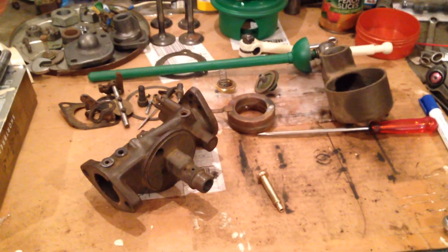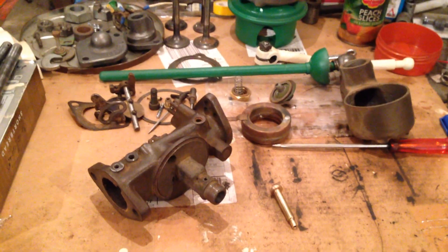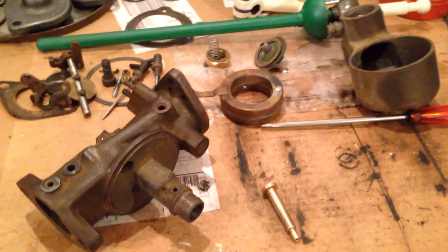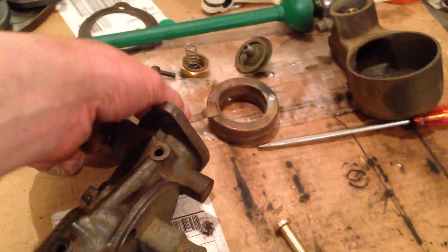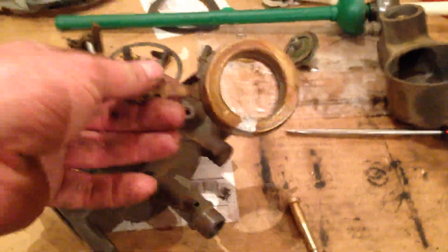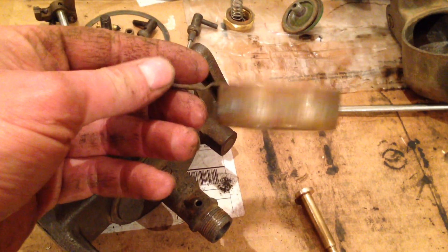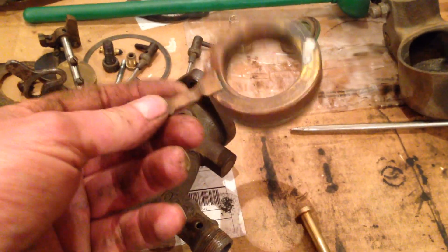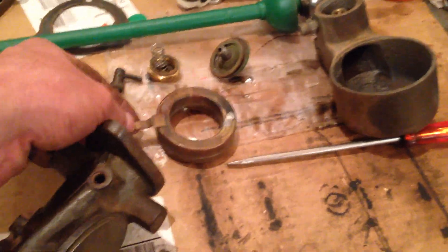There's been two or three videos posted on YouTube about it, mainly feeding sheep, and just recently it's been flooding quite badly when I've been trying to start it. Initially I thought it was possibly the old problem with the copper float, but as you can see there are some old repairs here. When I took it to bits the float is still airtight, still holds a vacuum — so it's not that.